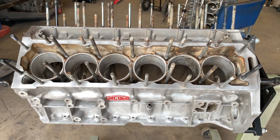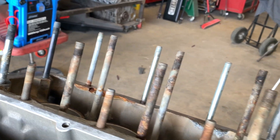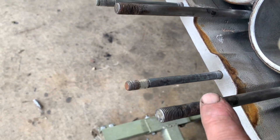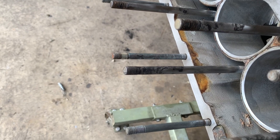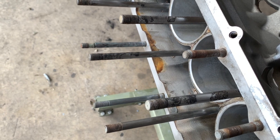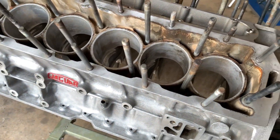It's why you want to use distilled water in your coolant. I've gotten a start on cleaning up the studs — you can see this is how they look right after you pull the head off, pretty ugly. You've got to inspect them for pits. There's a little bit of pitting right here, but these things are incredibly tough as anyone that has ever pulled one or two of these out of an engine knows. It's actually more stained than pitted. So if this was going to be a race engine, I'd replace them, but for a street engine I think that's going to work.